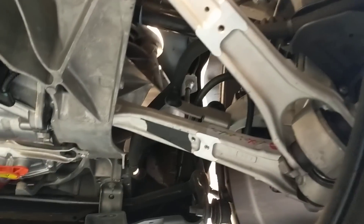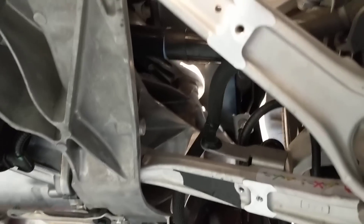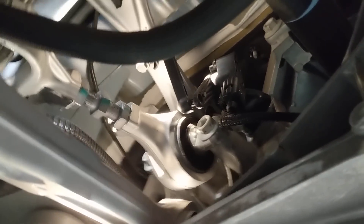The subframe is all aluminum and it looks like it's a clamshell, so the top unbolts. The suspension links are new — they're lightweight aluminum alloy, looks like forgings. We have an adjustable link that is familiar to or similar to ones I've seen in the aftermarket, so maybe the suspension is more adjustable than previous Model S suspensions. There's the level sensor for the air suspension and a big heavy stabilizer bar across the rear.